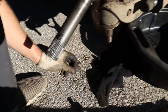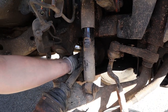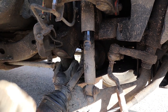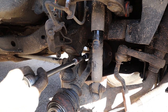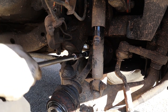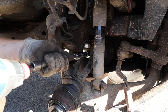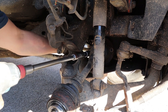But you must have heard me say on the video, try and get the spanner at the back and get it to rest against something, and use the tools that you have to your advantage, you know. So if I'm going to be turning it anti-clockwise, make it so that the spanner is going to rest against something. If it was to turn anti-clockwise, then it frees up a hand for you to work a little bit smarter instead of working harder.